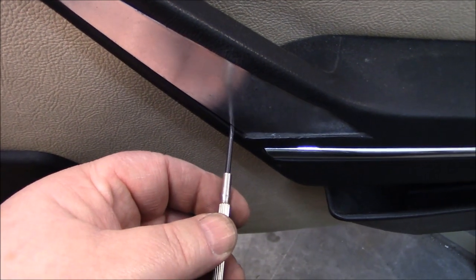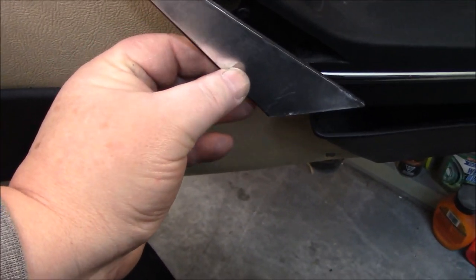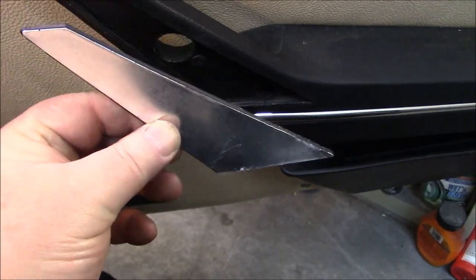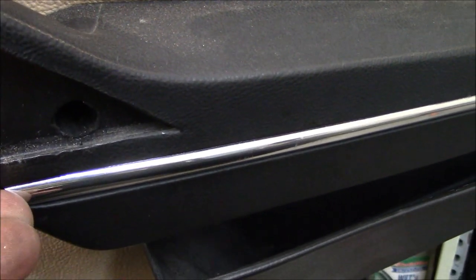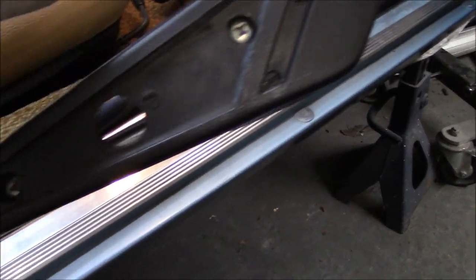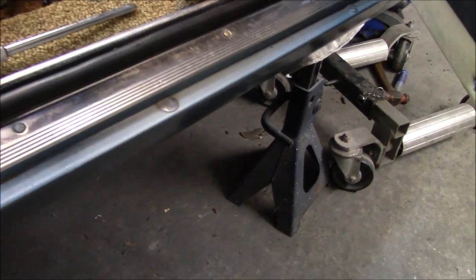I'm finding the loose spots and working my way around. There's that little plastic piece removed - it was easiest to just get a start with a screwdriver blade behind there and kind of run it around the edge and pull it out of the recess. In behind there you can see the screws - one there, one there for the armrest. There's also going to be more screws below this trim piece here. The door handle has been removed - there are three locations, one at the rear and two at the front. There are also some things that look like screws but they're actually just molded plastic.